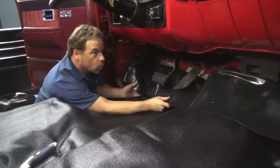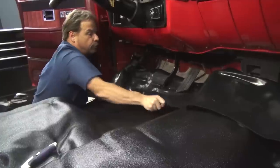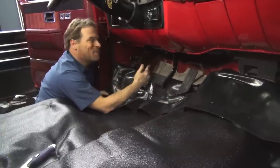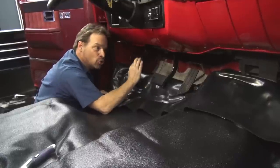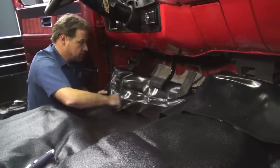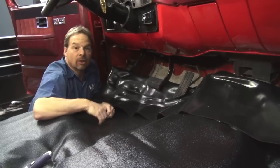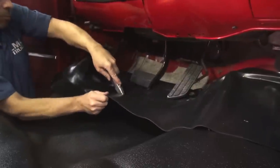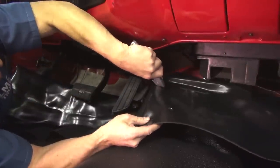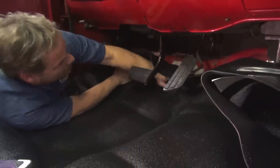What I'm doing is making sure that I know where to trim. There's a mold line on the front, right across here, and when I get it up there, I'm just double-checking, making sure that's my cut line, so I don't see any red paint when I install the mat. Now I can trim the top, stuff it up in there, then we can go for the sides. Use a sharp knife on this type of flooring — you'll get an accurate cut with a lot more control. Just be careful to know what's directly underneath your knife, so you don't cut your flooring or yourself.